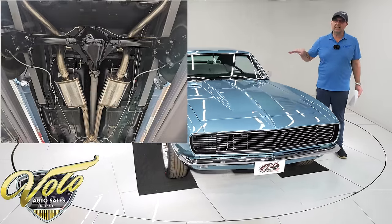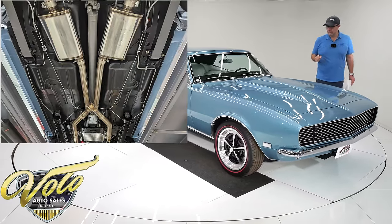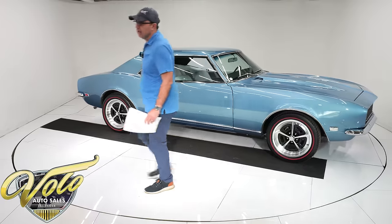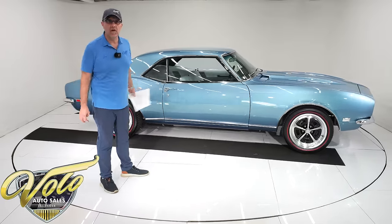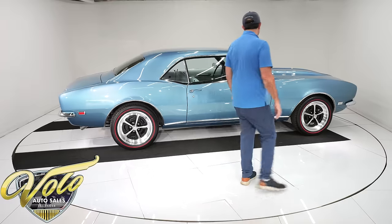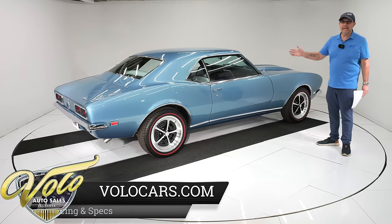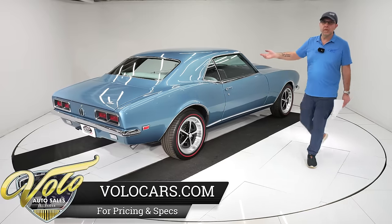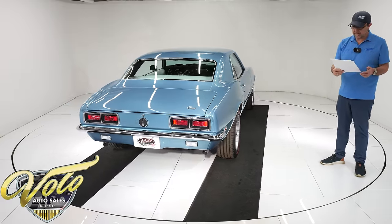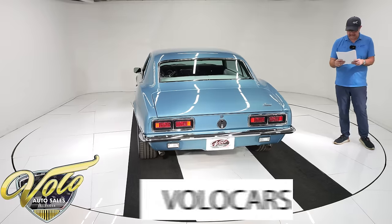It does have a custom stainless steel exhaust with an X-pipe and polished Magnaflow mufflers — I love the sound that engine makes. Fuel tank is shiny. Upgraded with disc brakes at all four wheels, and everything under there — the lines, the e-brake cables, hoses — it's all new. You look up at the motor and it's spotless; so fresh, so detailed, so meticulously put together. The Turbo 350 automatic was completely rebuilt with a finned aluminum pan. Rebuilt and balanced, powder-coated driveshaft. The 10-bolt rear end now has a 4.10 posi in it, all rebuilt. All the components — just lists of stuff that was powder coated.